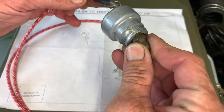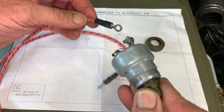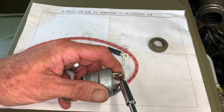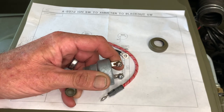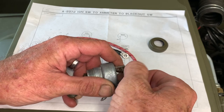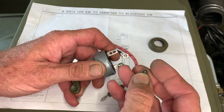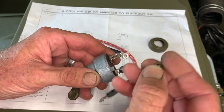The lobe on the switch is installed onto the dash facing down, as I've got here in my right hand. I'm going to attach that short wire to the top terminal, which should give me the clearance I need to reach the other side as well as the other connection that needs to go to the bottom side of the switch. I'm removing the screw from the terminal, and I can see it came with just a regular lock washer, which would be fine.